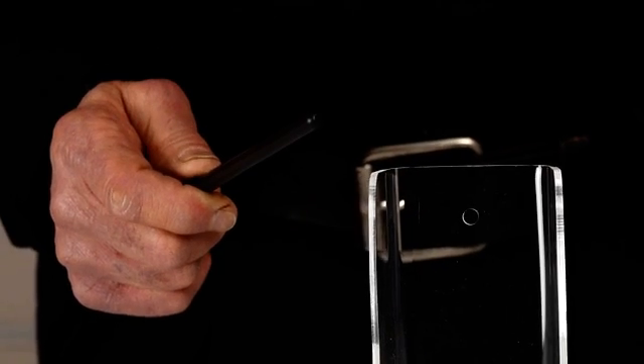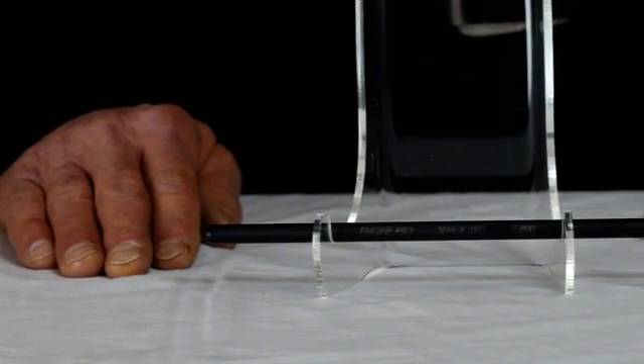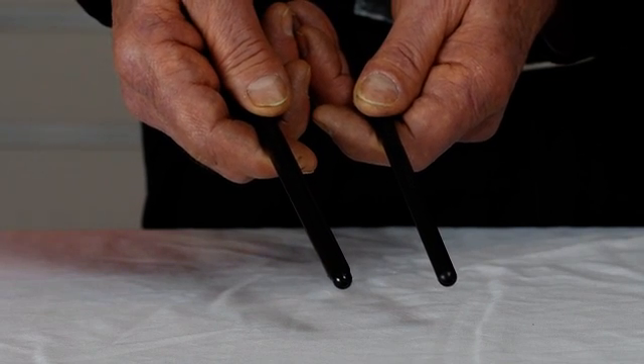chances are you're running our 4130 Premium Series pushrods. These pushrods are our biggest sellers. Made right here in the USA, these pushrods are made from 4130 chromoly tubing. They're 83 thousandths of an inch thick, carbon nitride treated to 60–62 Rockwell C scale. These pushrods are made to be used with guide plates. Each end is machined to 156 thousandths of an inch radius.